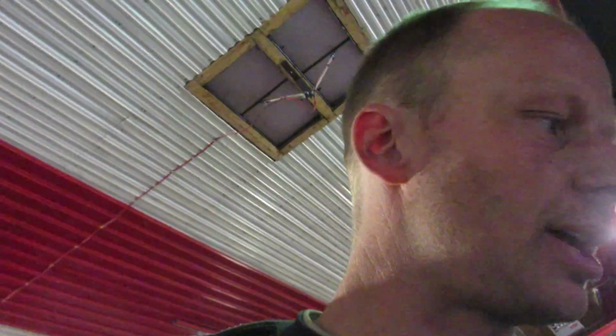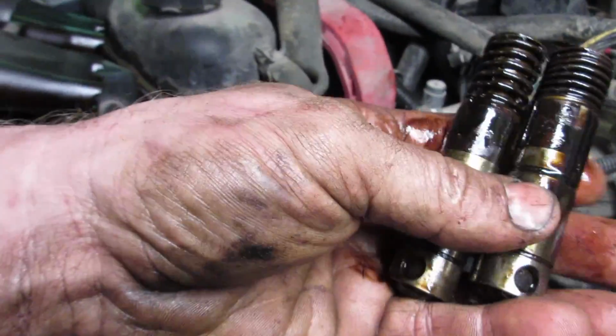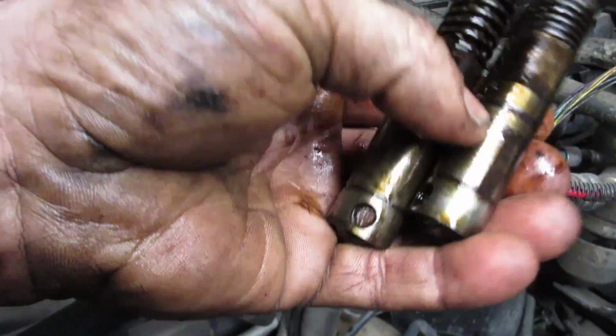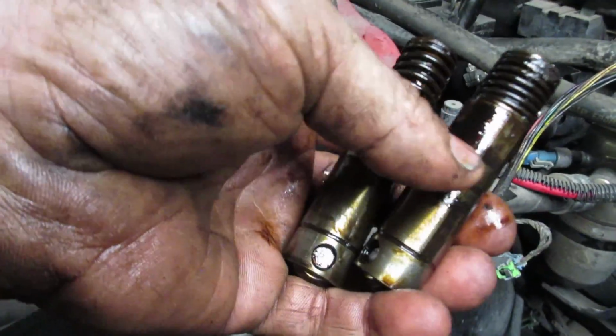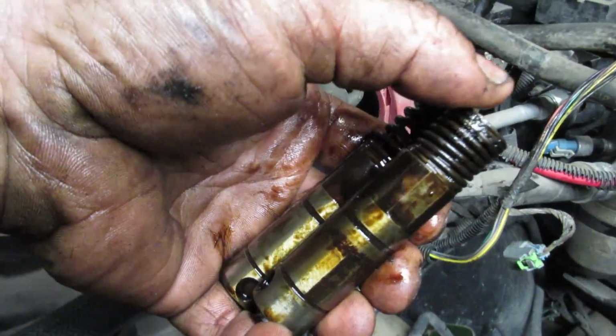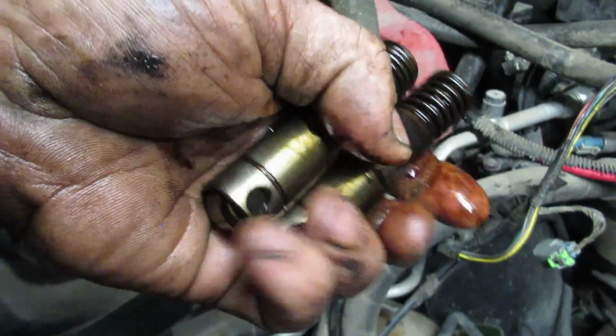Now, if you're hearing the same noise, you can just replace your lifter. There's upgraded ones with larger holes in it, because what happens is, on 4 cylinders, when you hit a certain cruising speed and there's no load, it puts oil pressure to these, and I forget how it works, if it takes the oil pressure away or if it adds it. Anyway, what it does is allows the inside of the lifter to collapse so that your valve doesn't open, and then it does something with the throttle plate at the same time to allow more air in. Anyway, it's a complicated, stupid system that when it breaks costs more than all the money you've saved in fuel.